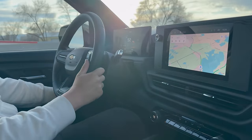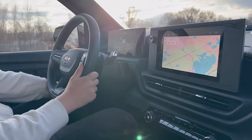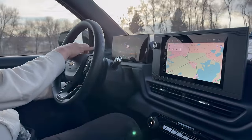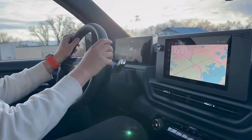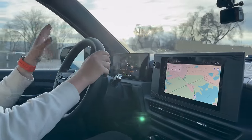Now, I have not floored this yet, but we're good. I'm just setting the trailer brake gain to 5.5. And as I squeeze, just making sure it works, yes. And I really love how as I squeeze the trailer brakes on, I get a percentage as to how much trailer brake, up to the maximum 5.5 gain, I'm getting. Really, this is nice. Really nice.